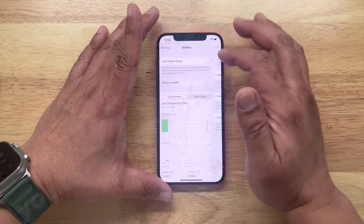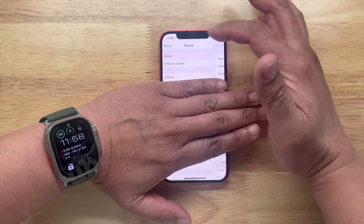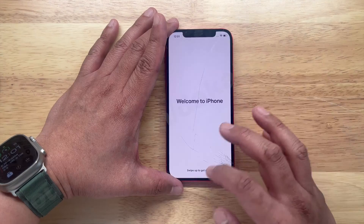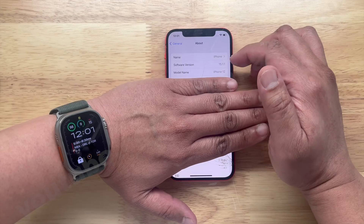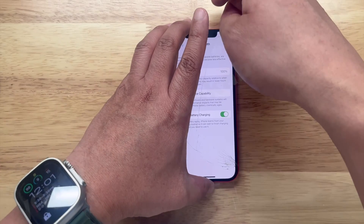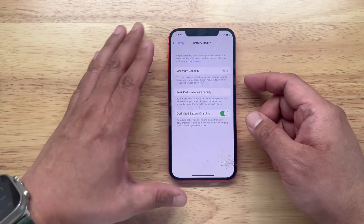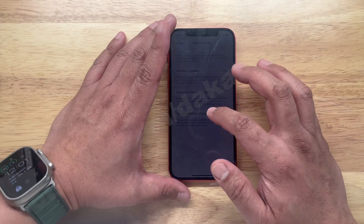Let's try the reset first. When we go here, it still says iOS 15.1. I'm going to do the reset, which will erase everything, and then set up the reset phone. When we go to settings and general, it's still the same — iPhone 12, 15.1. When we go to battery, it still says 100%. Mind you, it doesn't have a tag-on flex, so it's just the BMS — the original BMS of the phone.